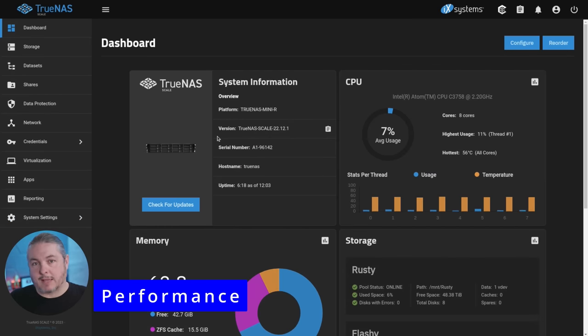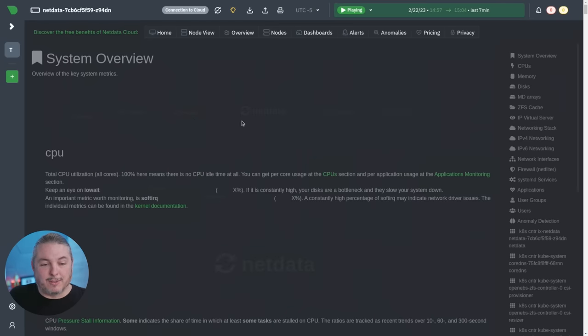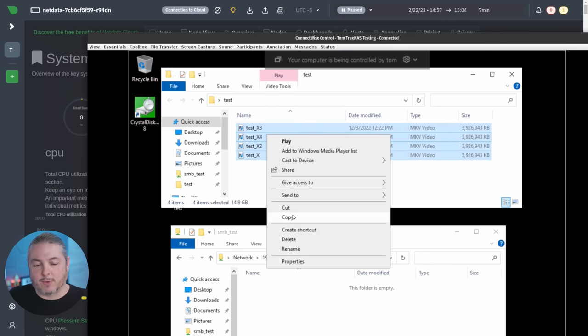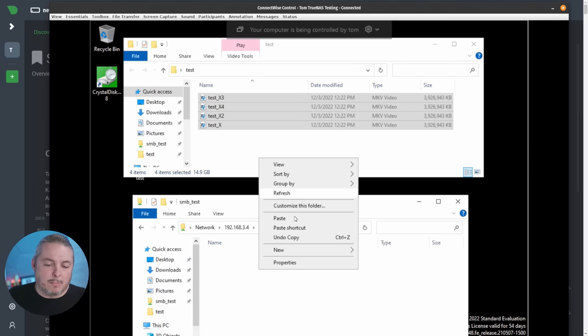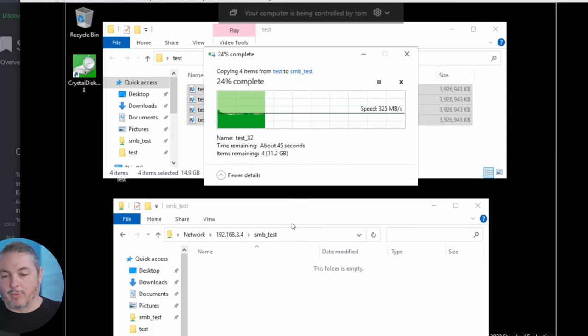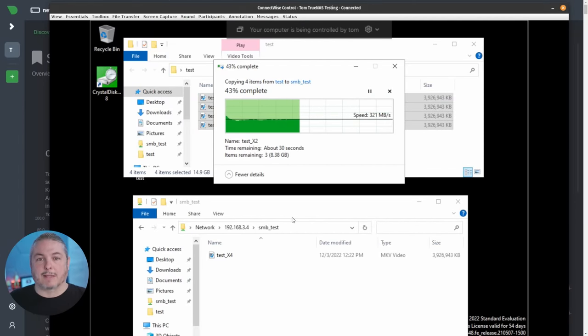I didn't run this through an entire battery of speed tests, because as I said this is probably not your most ideal setup for virtualization targets and high-performance storage. But if you're using it for the use case I suggested — SMB — you're probably wondering how fast it will transfer. So let's go over to Apps and pull up the netdata web portal, then transfer some files from a virtualized Windows server. We're looking at a transfer rate of about 300–325 MB/s on the write side. The big advantage with ZFS is the read cache, which will give much better numbers if you transfer the same files back, especially in a multi-user editing environment.